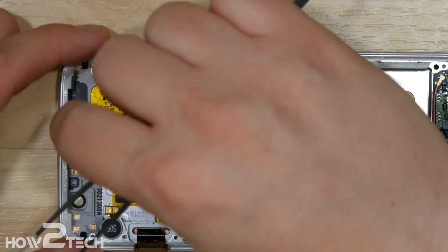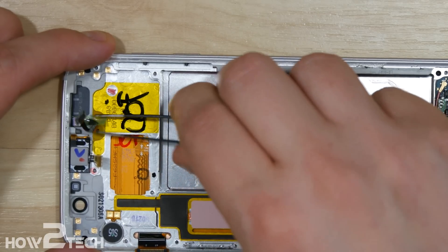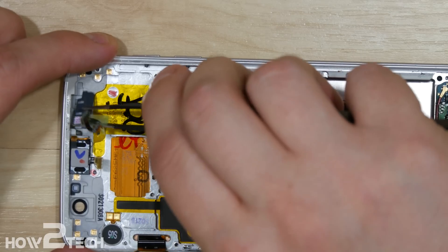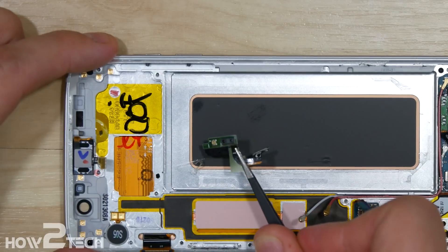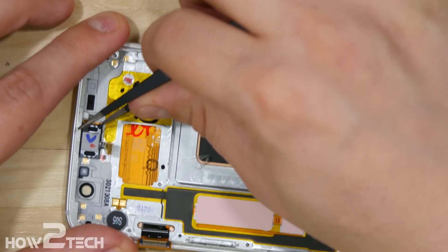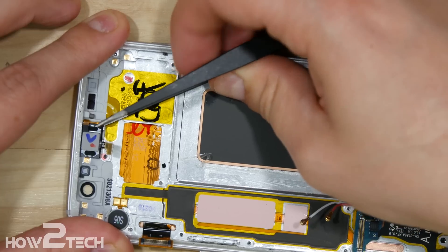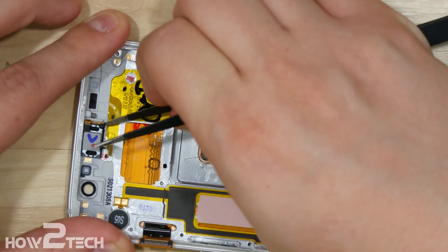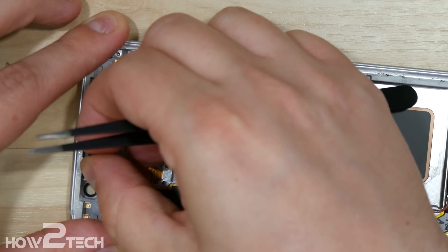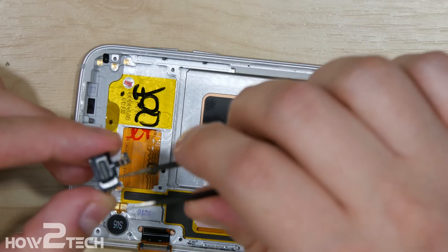Let's go ahead and work on removing the proximity sensor on the phone. To do that, we're just going to use a pair of tweezers to pull up — there's a little adhesive underneath the ribbon cable. Get up a little bit closer towards the proximity sensor portion and just go ahead and slide it on out. You can see we have our proximity sensor area. Go ahead and remove the earpiece speaker by putting the tweezer in right here in the top or bottom corner and just pulling upwards. There's a rubberized gasket on it that's adhered into the phone — you want to retain that, so be gentle as you're pulling it out.